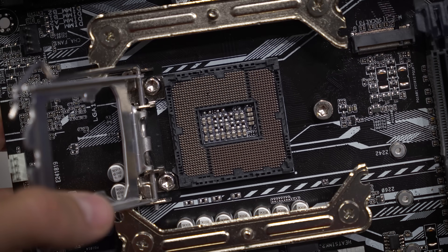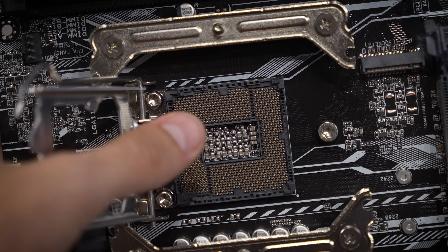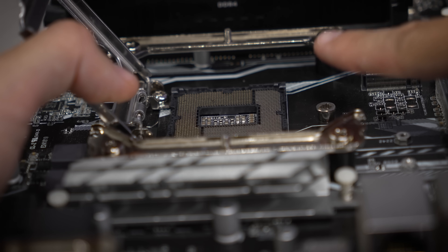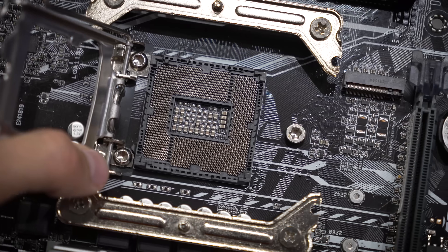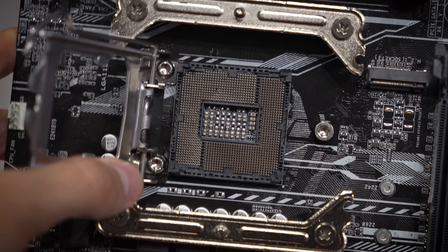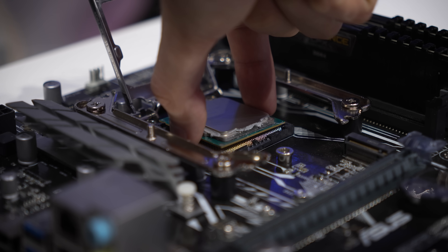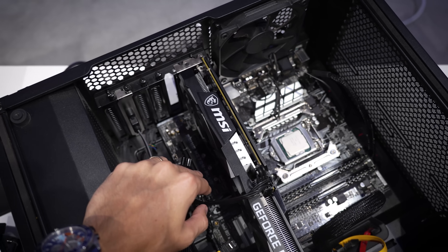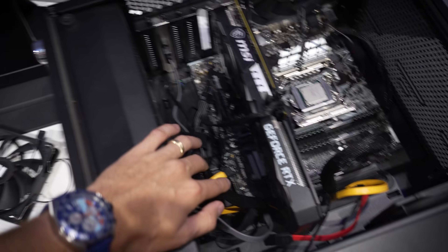At first glance you're probably thinking this is not going to post as-is. I'm not totally happy with how this one turned out — there's a pretty large gap up in the top left. That exists because one of the pins, the one that was bent all the way backwards, is still not totally flush from a depth or height perspective. I don't want to press on it anymore for risk of that pin completely snapping off. So I'm going to try for a post as-is. I think everything else looks pretty good — I'd say we've got a 75% chance this works. Carefully dropping the CPU back in, hopefully for the last time. I'm not going to put the cooler back on yet because we may need to take it right back off if this doesn't work. The graphics card is reconnected, the 8-pin, 24-pin, and 8-pin up top are all powered. We're going to jump the power pins and try for a picture.